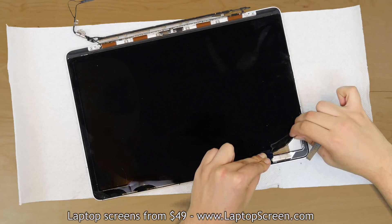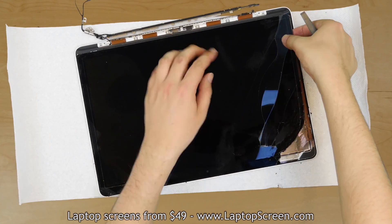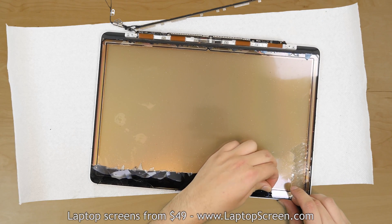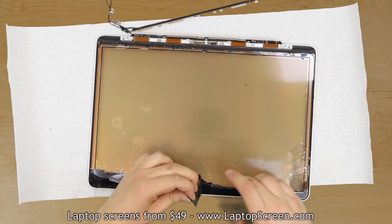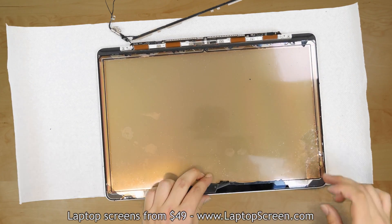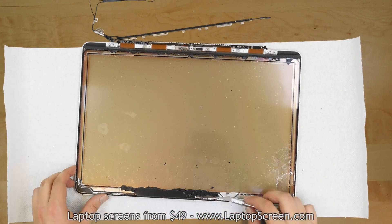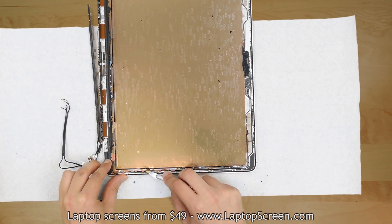The glass matrix will be coming off in small pieces. Patience and care are recommended for this step. If you are lucky, the display will split in two parts right along the liquid crystal layer. This will allow you to remove the top layer as a large piece with the back layer still firmly glued in. Very important! You cannot use the heat gun once the back layer is exposed. The diffuser sheets underneath the LCD matrix will deform at the slightest contact with hot air. Diffuser sheets must be safe for the reinstallation. It is not recommended to touch the diffusers and no glass shards may be allowed to fall on the diffusers. You can continue by hand to carefully and patiently separate the edge of the LCD matrix from where it is glued in without exposing the diffusers underneath.